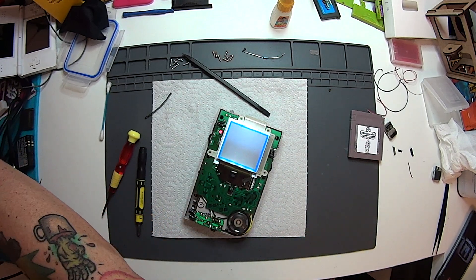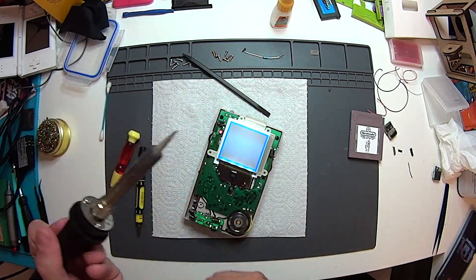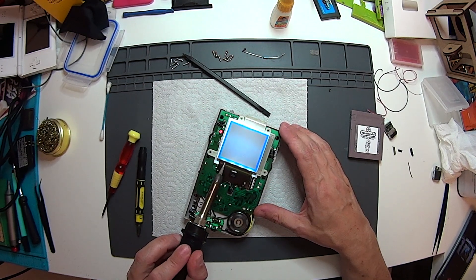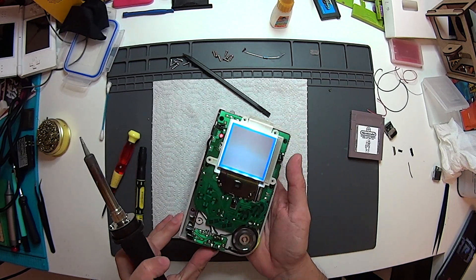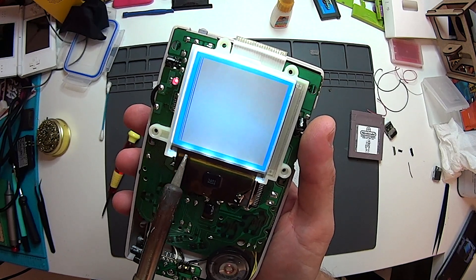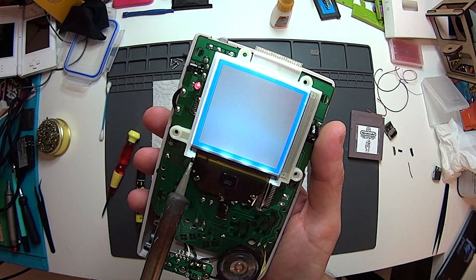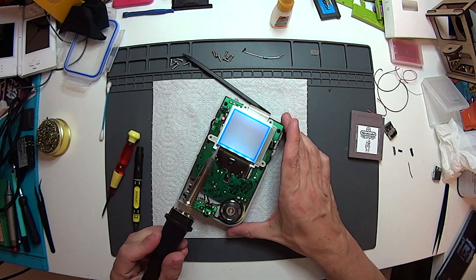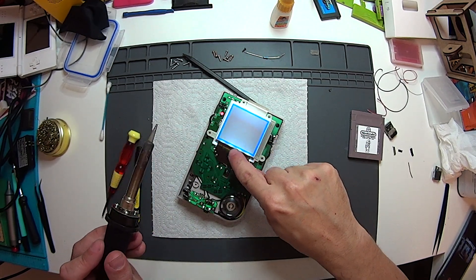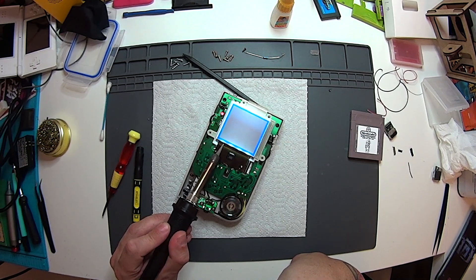You can just wipe the tip off on a wet sponge, or if you've got a soldering iron tip cleaner, put it in and wiggle it round — that will clean the tip and brighten it up. So let's see how this goes. It's tricky because there are no lines here at the moment, but as soon as I put some heat on you can see those start to appear. I'll normally work with it flat but I'll lift it up to the camera so you can see. When the heat's on there, this ribbon affects these vertical lines — you can see some starting to appear and then come and go on either side, but never any in the middle. So I'm going to reheat, starting from not where the actual lines are but a little bit further in — it's like you're smoothing them out, squeezing them from the centre out to the edge.